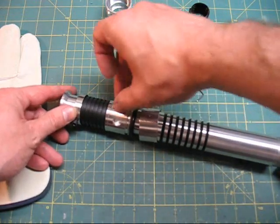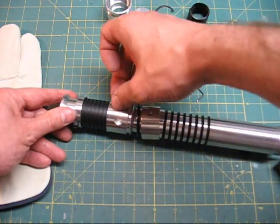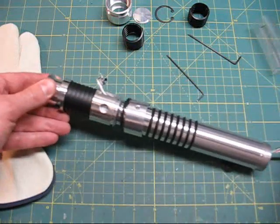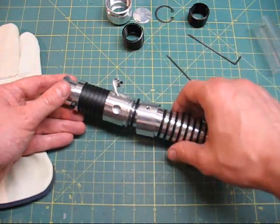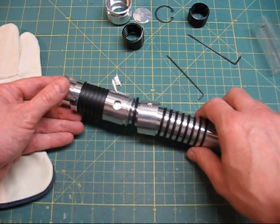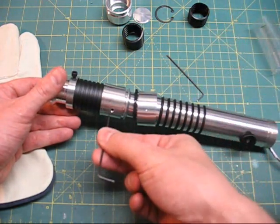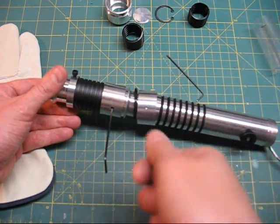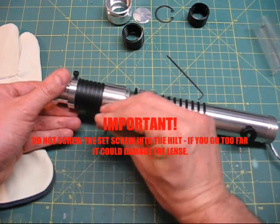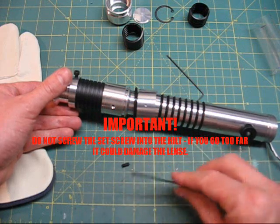This switch is actually a slide switch — it's floating in there. If you grip it with your fingers you can gently pull and work the wires out. The white wires of the switch are connected to the white wires that run all the way out. If you ever wanted to upgrade it, here's the auxiliary switch setup — you can slide wires through and mount an auxiliary switch there. Next, grab the 5/64th allen key again and go back into that hole. Instead of tightening clockwise, now go counterclockwise and back this screw all the way out. Like a samurai sword, that little set screw holds the whole thing together — removing it frees the inner optics.